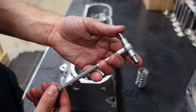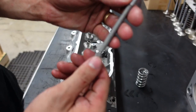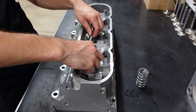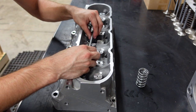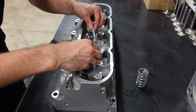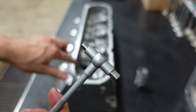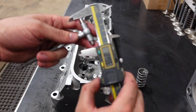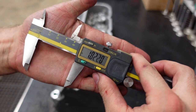These are called snap gauges — they're super convenient for finding diameters of certain objects quickly and easily. They have a little release on the bottom. We compress this down and stick it inside, expand it, and check it the other way to make sure we have a good measurement. No matter what the step is in engine building, your measurements need to be exact. The diameter of these two little anvils is the exact distance between that locator and the top of the retainer. Then we take a set of calipers and we have an installed height of about 1.82 inches.